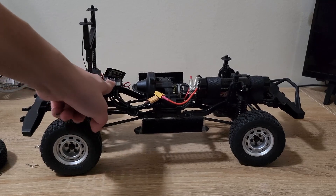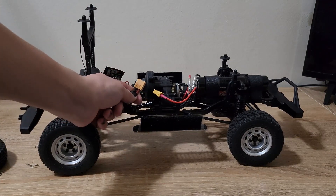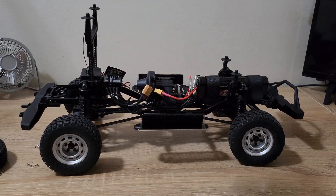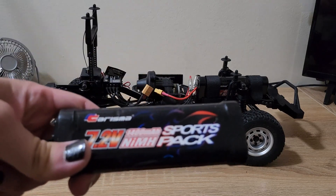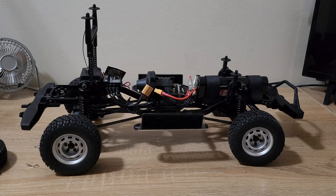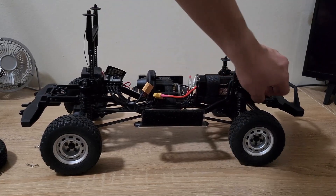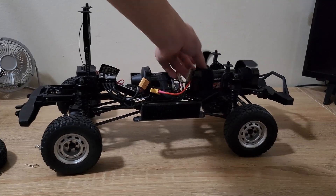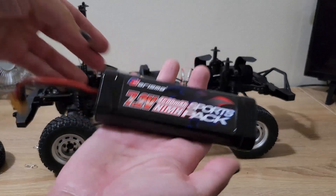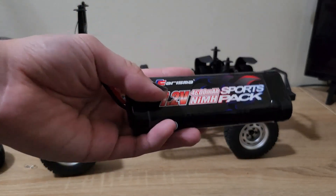The ESC is different — so upgraded ESC, the ARC-2 instead of the ARC-1. The standard ESC comes with a Tamiya or Molex connector; the upgraded one comes with an XT-60 connector. The battery is a nickel metal hydride pack. The stock battery they include is honestly super insulting — it's a 1400 milliamp hour pack, so at that point just don't give me a battery and take some money off the price. But this Limited Edition comes with a much nicer 4,600 milliamp hour battery pack, so I'm really happy about that.